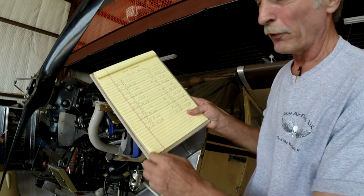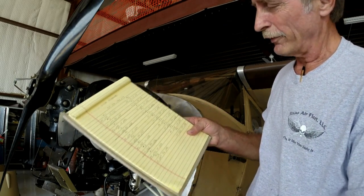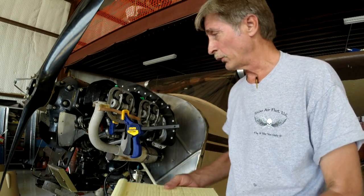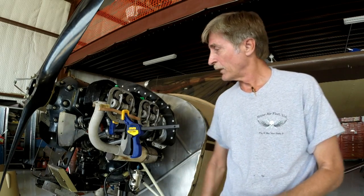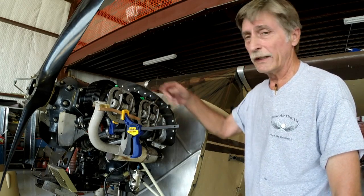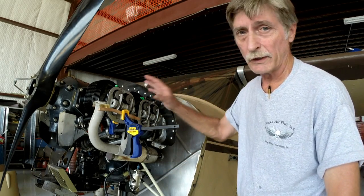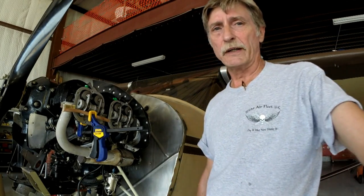You can see that I've come up with reasonably decent numbers. I really wanted them all to be somewhere around 0.06 to 0.07, however I'll take what I've got right now. I've spent an extraordinary amount of time doing the combination of pushrods and rocker arms to get this all within the book values. Now that that's all done, nothing left but to clean up this sheet metal mess, put the valve covers back on, pull all my plug leads around and hook those up, get my baffling all together, throw the cowling back on, torque down and get my propeller reinstalled, and then it'll be ready for a test run. So boys and girls, check back with me in a little bit and we'll see what goes from here.